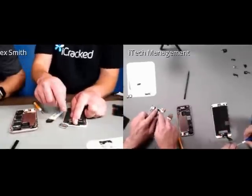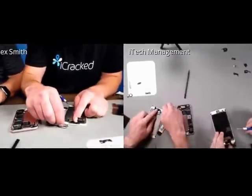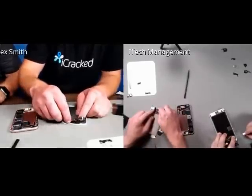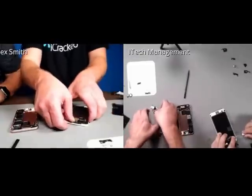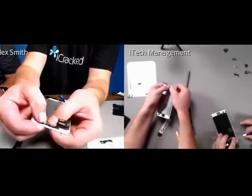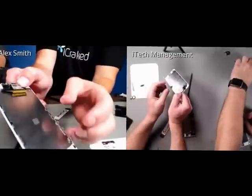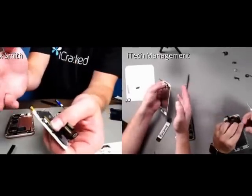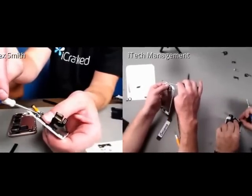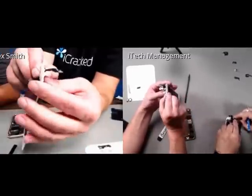And Ed, can I put on all of this stuff before I put the thermal plate back on? Yeah, actually you can, because none of this screws into the thermal plate, unlike the 6 and the 6 Plus, where it did require it. So I put the plate on right there, and I haven't screwed it in yet. If it's not set up correctly, you'll feel it compressing outwards on one side more than the other. It probably means one of the sensors is not actually in its canal correctly. So we are going to make sure it's a snug fit.